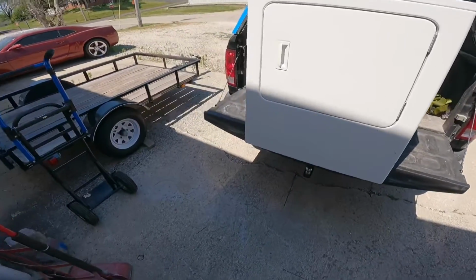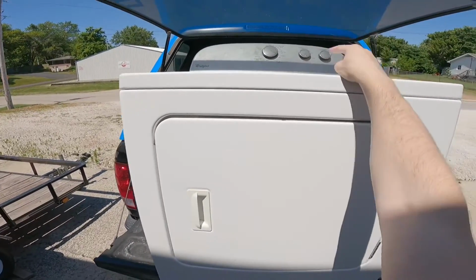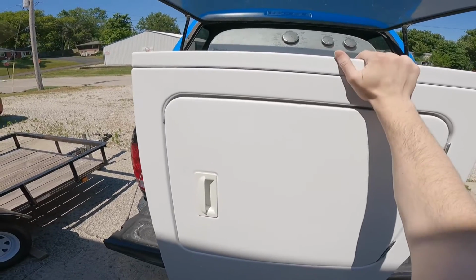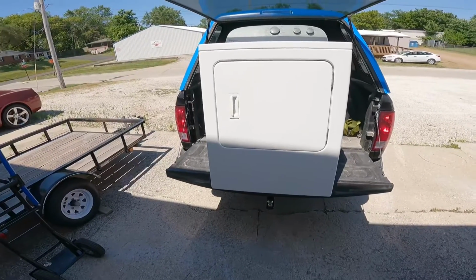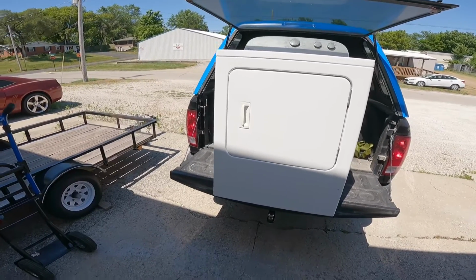It'll work with a washer too, and it works best if it's facing you, so you have the smooth side with the console on the back. Gives you something to grip as you pull it down. And I absolutely do not recommend doing front loaders by yourself or even putting them into the back of a truck. They're so much heavier. This method does not work with front loaders.